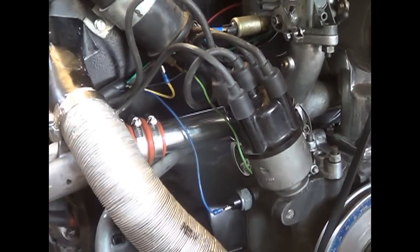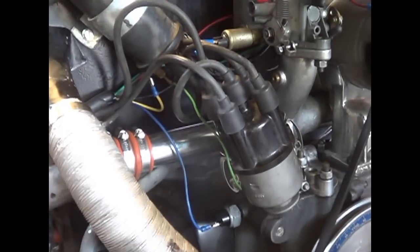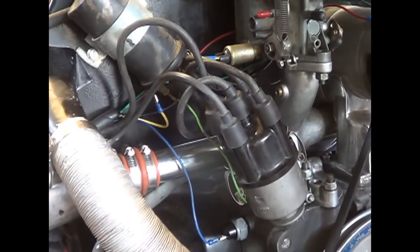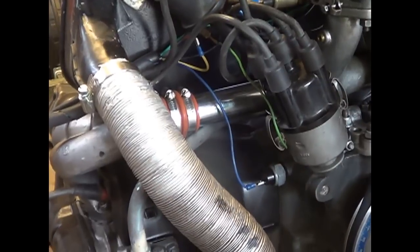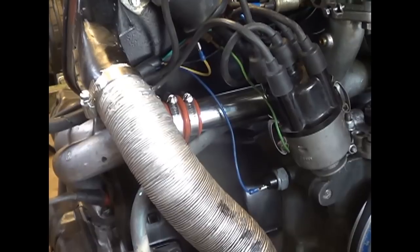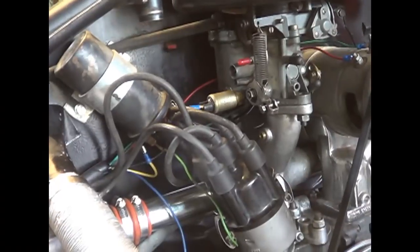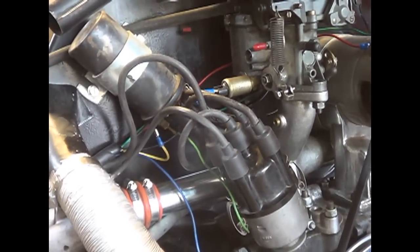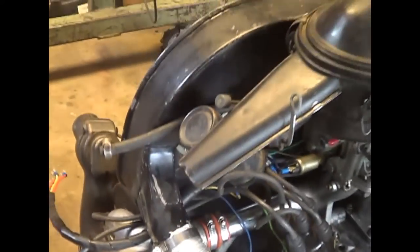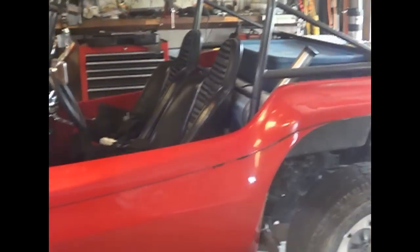There's too much hype and bling and glitter in hot VW magazines and all these people that supply parts. They're trying to sell you merchandise. If you want a show car and you want an off-road capable car, it's going to cost you a lot of time and money. Just be prepared for that. If you're on a budget, stick with a stock engine. I have a stock cam in my 1776 with a stock carburetor that's jetted a little bit fatter on the main, and I love it. I have a low compression 2-liter in my fiberglass car, and I love it. I have a stock cam in that as well, but I use ratio rockers.